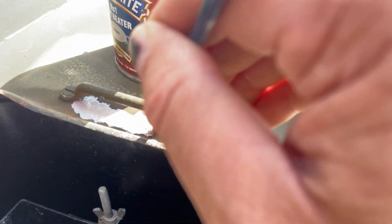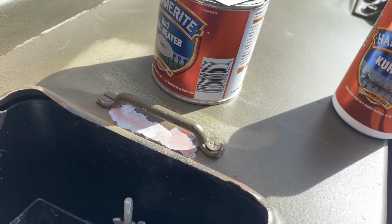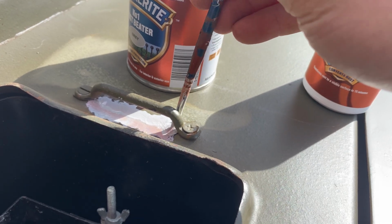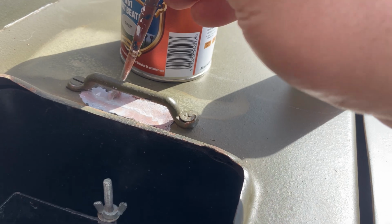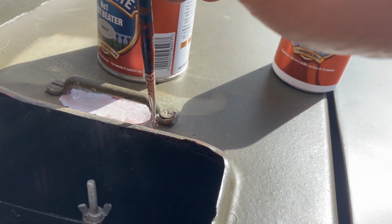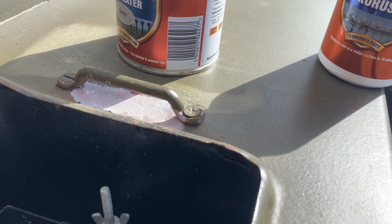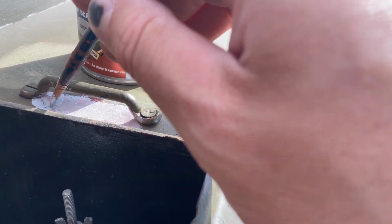The little pinkish tinge that you can see is the paintbrush I've used. Although I've cleaned it loads of times in white spirits, it has still got the remnants of red oxide primer, which, being an oil-based paint and from the same company, Hammerite, is completely compatible with this grey primer.